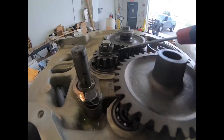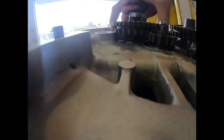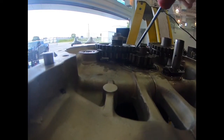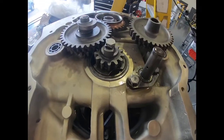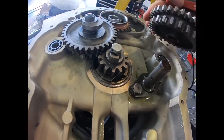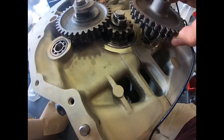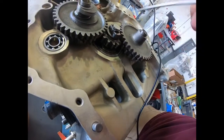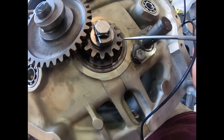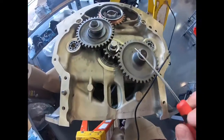We also have to make sure the single stamping of the crank lines up with the two teeth on this gear. You may have to adjust your angle and lift as necessary. The single tooth and the two teeth are sitting right between the two on that one. So the last gear to line up — there's the tooth with the etching zero on it. We find the markings of the two on this gear, then line up the two teeth with the zeros etched on them, straddling this gear with the single one. Now this one is synchronized.